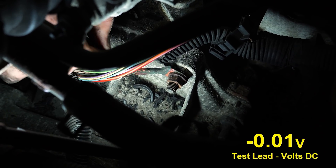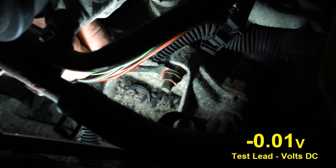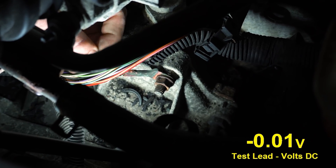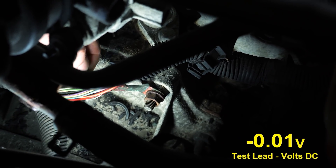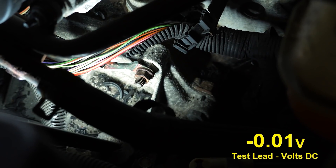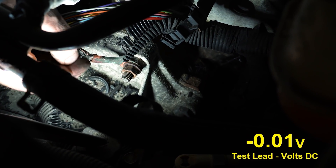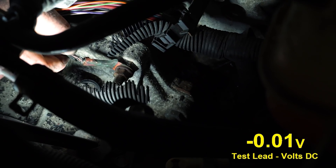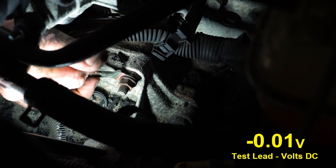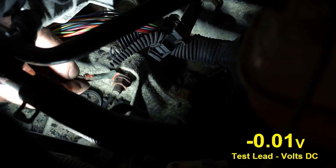The car was warm and I had it running for like two minutes and then it quit. I watched the resistance keep climbing all the way into the 20,000 range. I had a change right there — I'm trying to take the tape off so I can pull on the strands individually. You said they break right after where it's crimped because they solder them together. The problem with wires like this is the more you wiggle the more you fix it.